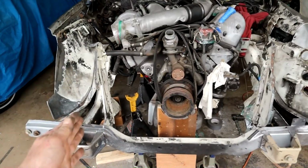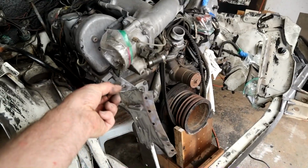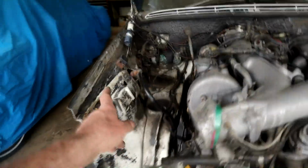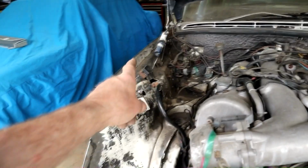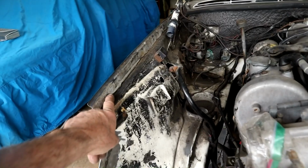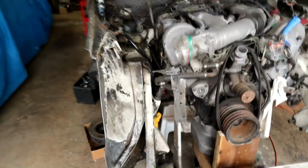So then they give us a good reference point to spot weld here and here to the radiator surround, so they're a fixed reference point. Okay, and also our reference point is the bolt holes where I can remount the fender, and then make sure that all the mount holes from the patch mounts and connects here. Then we've got a hole here and a bolt hole here, so we dry fit everything, make sure that lines up nicely. And the same for this side.